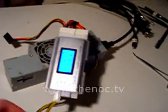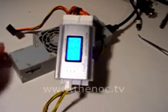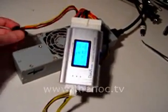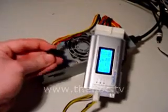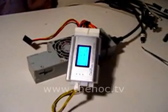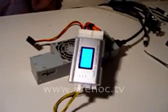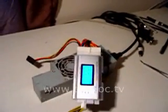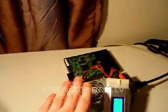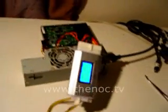In this particular case, I know this power supply is bad. The reason we're not having any issues on this test is because we're not actually putting it under load. If I hook something up to the SATA, it'll probably stress the power supply enough that we could find that it's bad. So I'm going to disconnect the power and hook up a SATA to it as well. And pretty much just like I said — if I hook up a SATA drive, it will basically cause some voltage issues with this power supply, which I was correct about because I've already tested this one.